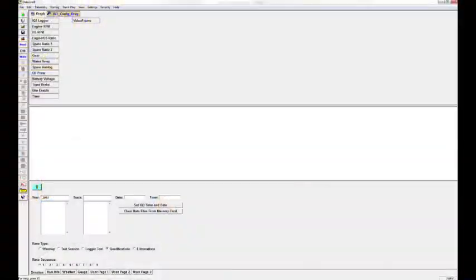So from there, while we're on this screen, at the bottom, you want to take a look at where it says year, track, date, and time. Now, this is very important because the Racepak program actually houses all of your files when you do this. Every time you put in a new year, 2017, 18, 19, et cetera, it's going to create a year folder, and then it's going to create a track folder for every track you go to. So Pomona, Vegas, Boise, Dallas, wherever it is, every track you type in will actually house its own folder. That way when you go back to reference all this stuff, you know where it is. Again, we'll discuss that in a different software seminar, but I'm just giving you a little bit of a run through.